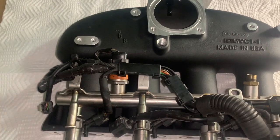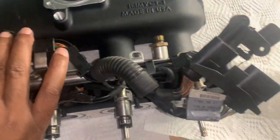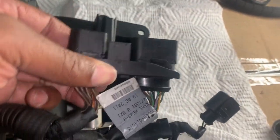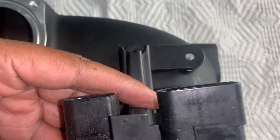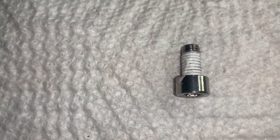To recap: I put on the intake air sensor, put plugs on for my meth injection since I'm not going to use those four injector ports, and put on the fuel rail from the OE intake manifold. Now there's a wiring harness here for the knock sensor and the component that powers the actual fuel injectors and the general electrics in the car. They pretty much make it a plug-and-play fit.